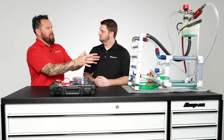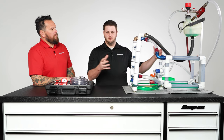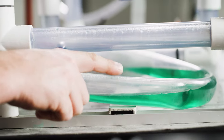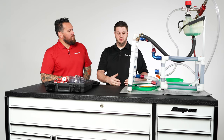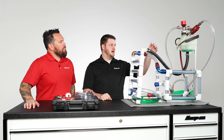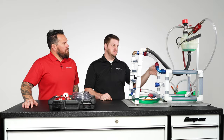We've talked about the system and now we have a demonstration over here. This is a very rudimentary model of what a cooling system on a vehicle is — you've got an engine block, radiator, upper and lower hoses, thermostat, sensors, and whatnot. The demo will show how to quickly refill your system while pulling vacuum with this tool. I'll get up on the ladder so I can see that we've reached maximum vacuum. Once we do that, we'll close the system off, then pull vacuum through the coolant and fill it up.